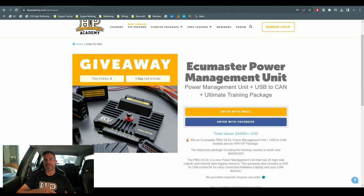With a conventional fuse and relay system, once that fuse blows you have to physically replace it. With these power distribution modules, we can electronically control the fusing and set them to retry circuits a certain number of times — a really good limp home function, particularly powerful for race cars. You can shut down certain non-critical functions if, say, the alternator fails, and give yourself the best chance of getting the car back to the pits.